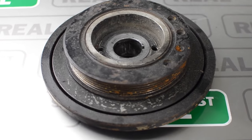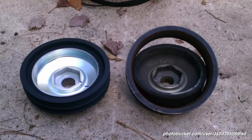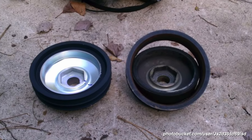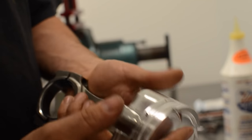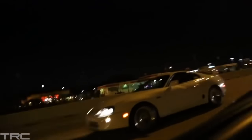As the factory balancer ages, over time the rubber deteriorates and it will allow the ring of the balancer to slide off of the hub. The factory balancer can also fail by changing the frequency that the engine operates in. If you change the reciprocating parts of the engine — pistons, rods, things like that — it changes how the engine was balanced and what vibration it makes. High RPM can exceed what the factory balancer was rated for, creating the condition where it can swing the ring off also.